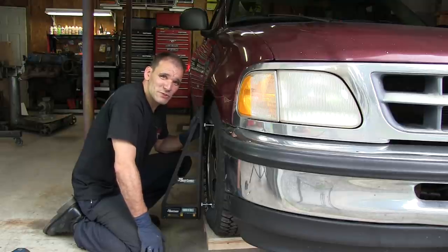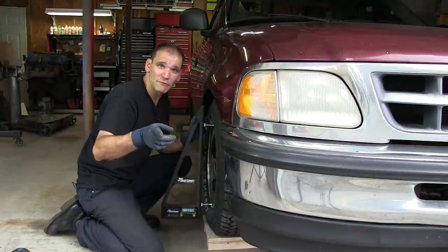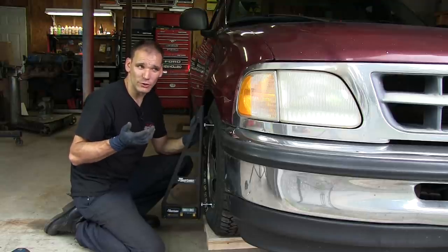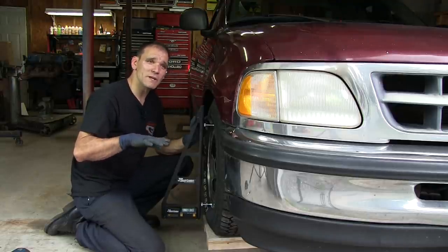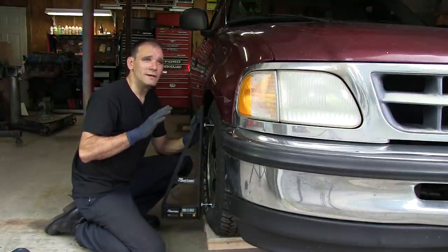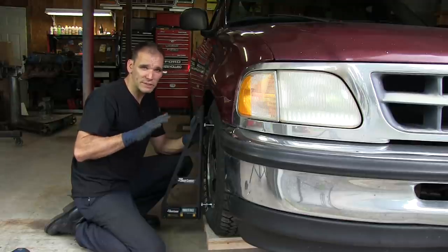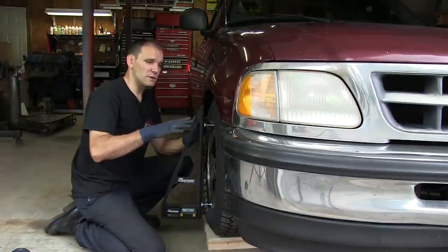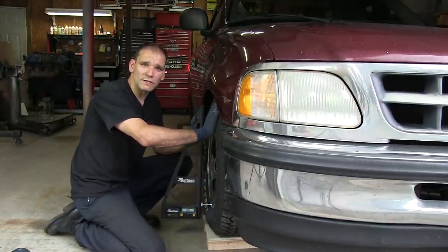And that's just too much for the street. For this truck, it may be okay for your vehicle, and adding negative camber will actually help cornering, but in real environments, you can see negative side effects. So I'm gonna take that in a little bit. I'm gonna try to get us closer to like 0.6, 0.5, and I think that's actually gonna be a better result for this truck for the kind of driving that I do.